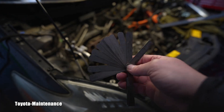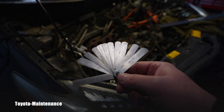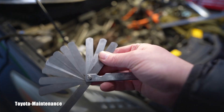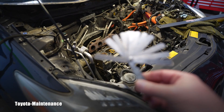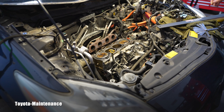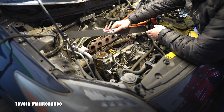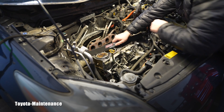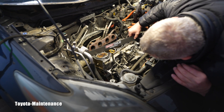I'll be mainly concerned about this area of the block. If there were a space between the straight edge and the block, feeler gauges would be used — the thinnest one might be permitted in spec. But in our case, you'll see there will be no way to insert even the thinnest, paper-thin gauge underneath that straight edge. I'm just re-checking that there's no dirt on the straight edge, and finding a position where it will fit. I also want to avoid the piston that's sticking out here.